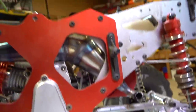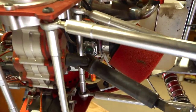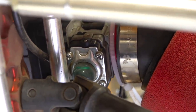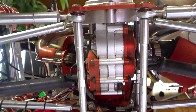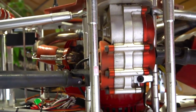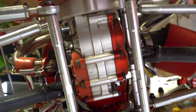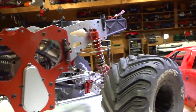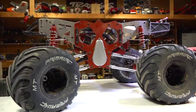We do have this stock engine in here. It does have a carburetor, but the carburetor only has a high-speed needle. There's the primer bulb on one side, and on the other side is the idle screw and the high-speed adjustment. One thing you guys may not know: you're all saying it needs a two-speed transmission — I would agree — but look at this: it's CNC'd and has a reverse gear in it. It can actually go in reverse. It's like one of the first big gas-powered monster trucks to have a reverse gear. That's pretty phenomenal.